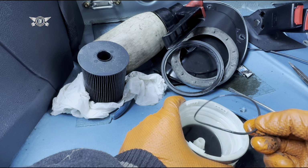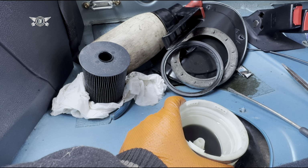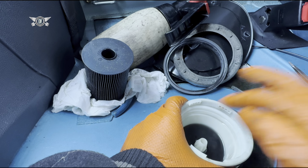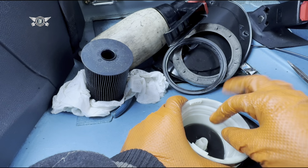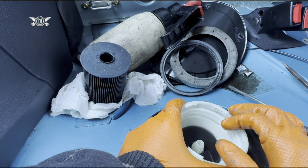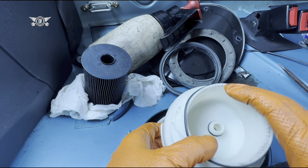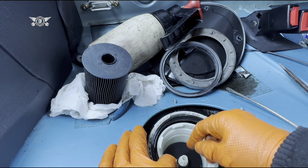That's the O-ring, which is the annoying O-ring that is sitting around the outside of that thing, but it basically goes in here. But anyway, and there is another O-ring inside of here, just around there, a little one like that one there, inside here. There's one there. So technically fuel comes out of here into the fuel filter, and then it will flow out to the sides and into the, well, actually it's supposed to flow out of here. So technically the fuel comes on the outside, it goes into the filter, it gets filtered, and then it comes out of that hole.